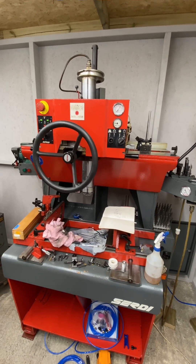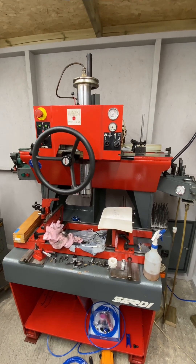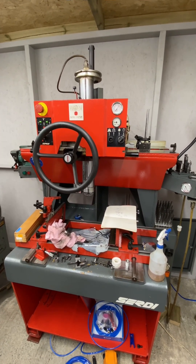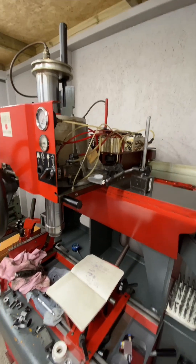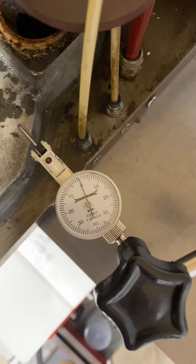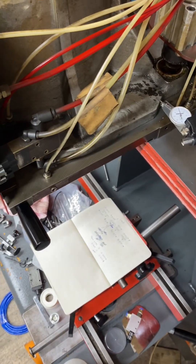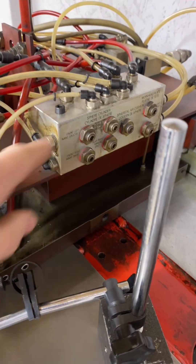I haven't even cut a valve yet to see how it goes. I haven't got the concentricity tool — it's about two thousand pounds for a seat one, and for a valve it's about 350 pounds. Half that price in America of course, with shipping and import taxes really doing some good. I'll just move around to the rear — that's 0.05 on the back, 0.03 on the front — let's see what the other side is and then we need to get into these and start adjusting them.